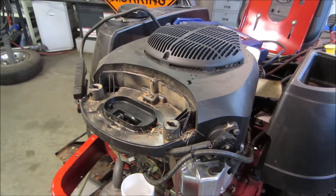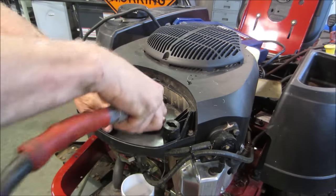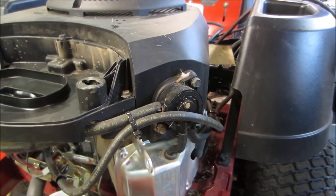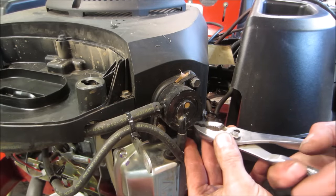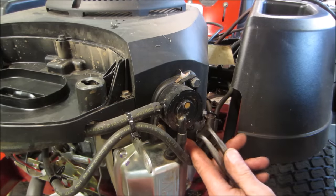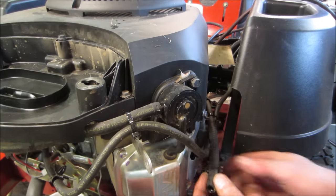If and when it does fire up, why don't we get rid of some... These pumps have like little valves in them. Not too far from like a heart does, you know? It's got little check valves. Pulse goes one direction and closes off a valve and the pulse comes back the other. And especially with today's fuel, they can get sticky.